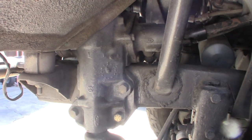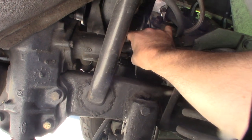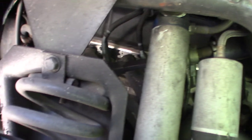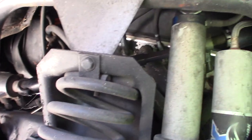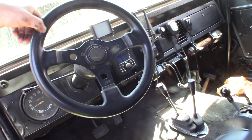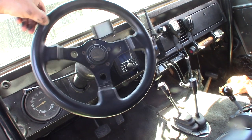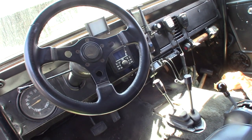This joint seems like it's nice and tight, but sometimes you can get play in these little u-joints here. I think ever since I got that shaft — I originally got it when I did a one-inch body lift. That's a lot of play in the wheel. I looked at the steering gear and tightened that up.